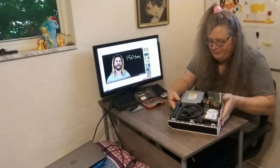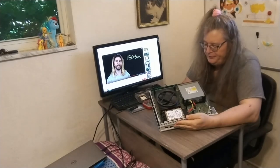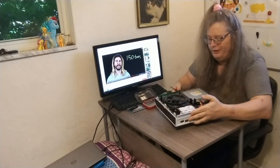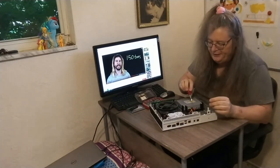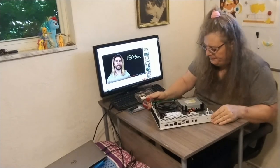You can see inside the Xbox, it's basically typically a computer. You got a large cooling fan, heat sink, GPU, there's the optical drive, it's just a standard 2.5-inch laptop drive. In this case, it's a slow 5400 RPM mechanical drive. And here's a standard SATA cable, although there is a sort of proprietary Xbox adapter, little clip-on thing here.